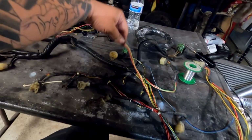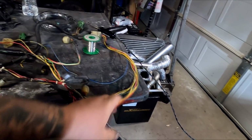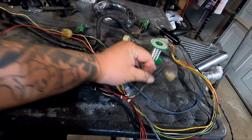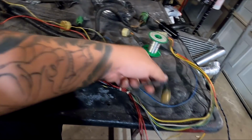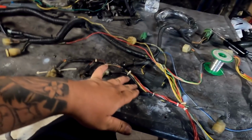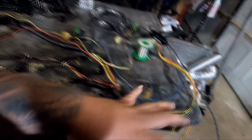So I'm going to go ahead and route these through the loom, these 2 and the dual point wires soldered together, and then I'm going to show you the yellow resistor wires. You can see the IAT sensor is right here joined in with the junction, because the IAT is typically in front of injector number 1 and 2 for the OBD0 SI manifolds, and that's zipped into place, so that way I know to loom it up right here.